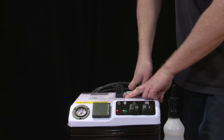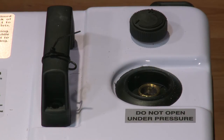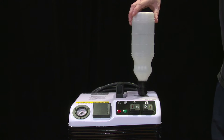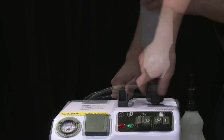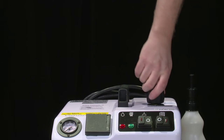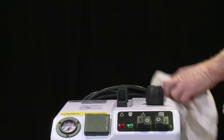When removing the fill cap on the machine, always make sure the gauge is reading zero and there is no pressure. Fill with clean warm or hot water. The opening of the tank is narrow, so using a funnel or filler bottle will help avoid airlock while filling. Shaking the machine slightly while filling will break airlocks if they should occur. Replace the cap and screw back on until only finger-tight. Over-tightening the cap can lead to premature wear on the cap seals. Wipe up any water with a clean cloth.